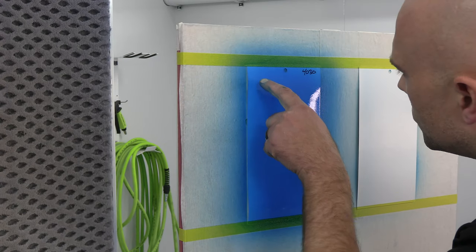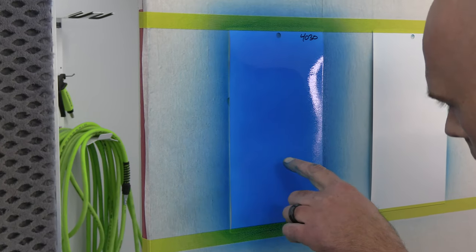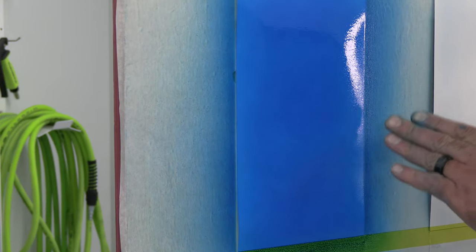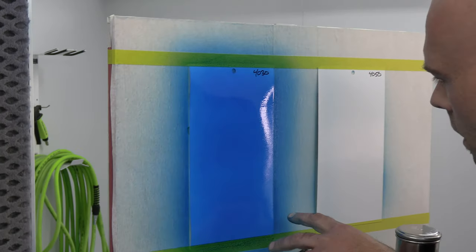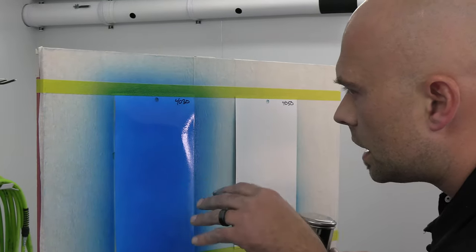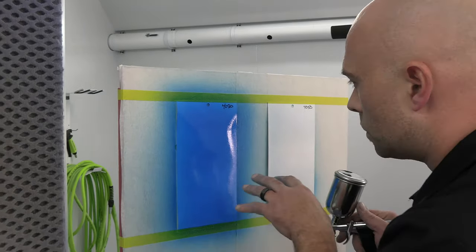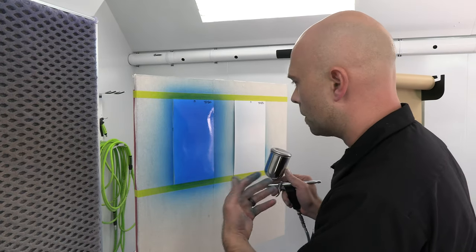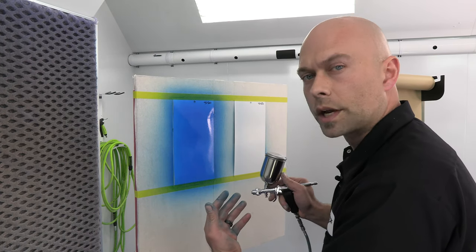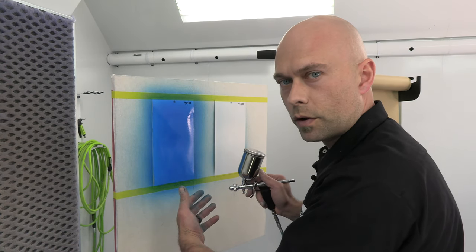On the edge, it's starting to do what we talked about. If you did go too heavy, you would start to get these little imperfections in the surface — the 40-30, because of the nature of it being a little bit skinnier, will start to almost miniature fisheye. That's what we call the cratering, where it tends to have an uneven surface. This is like a medium wet coat — you would not want to go any wetter than that. So again, we say to work in layers, but we'll show you what the 40-50 can do side by side with the 40-30.